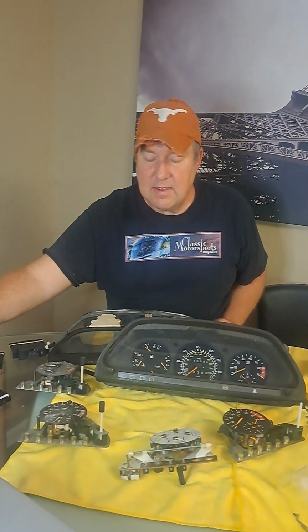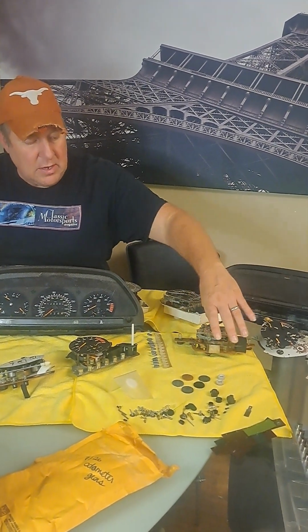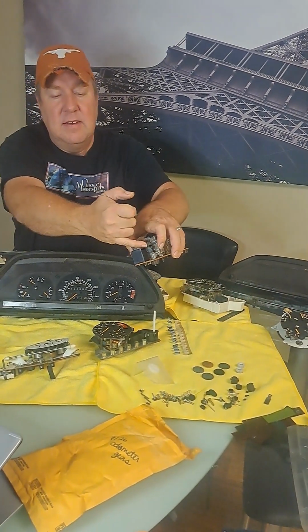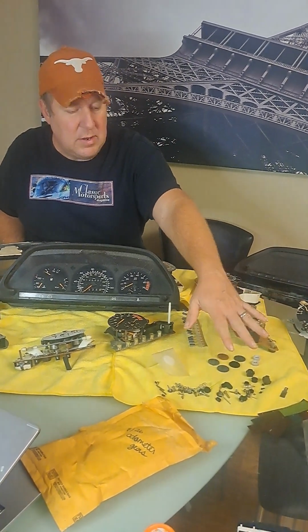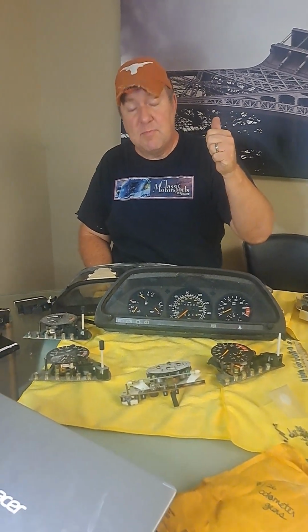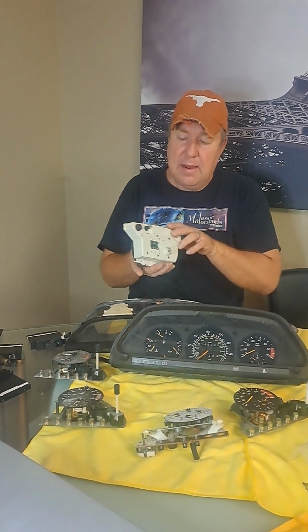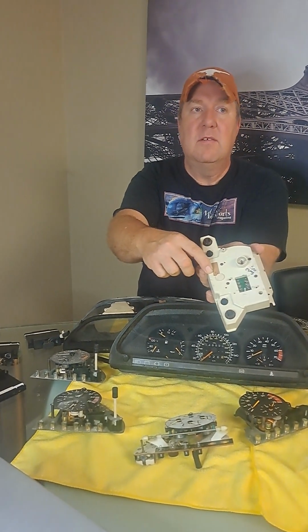Again, as I said, we're going to divide this up into a couple different videos, but I just wanted to give you some of the basics. One of the other things that goes a lot is the wheels that keep track of your odometer. You'll see that they have a tendency to disintegrate inside just because of the plastic that they're made of. There's many odometer wheels. You have to get the right ones because each one of the speedometer and odometers are set up for a specific engine and a specific rear end. And how you can tell that is usually by the sticker that's on the back. There'll be a sticker that'll say what it's set up for.